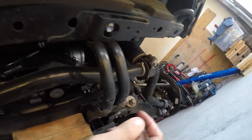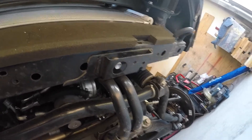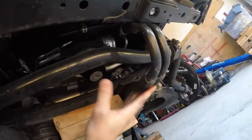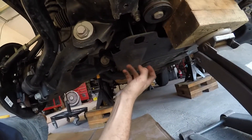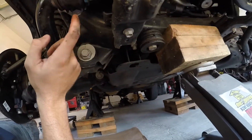The hydraulic lines are going to be connected to the ram. Really, the removal of this is just taking it apart at the bolts, getting them out of there, and pulling it off. I'm going to unbolt some things around this area like these supports that tie in the subframe, and then this pan, and then we can expose this and undo some bolts and pull it off.